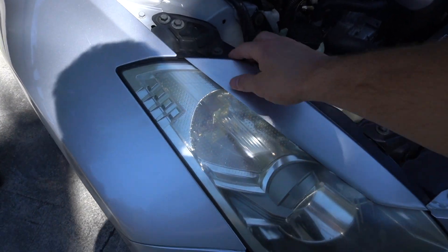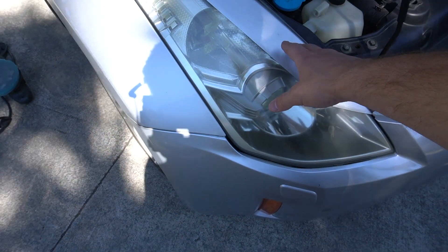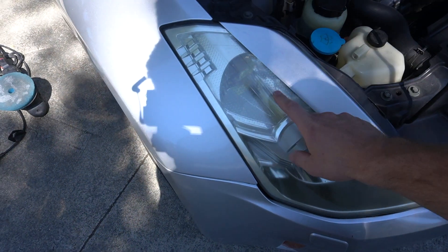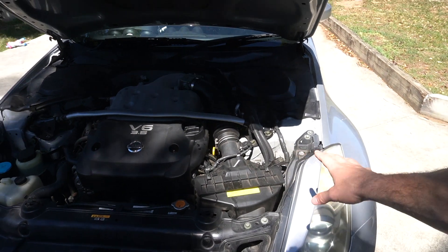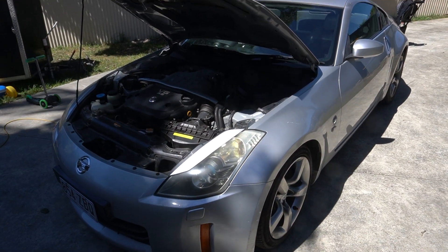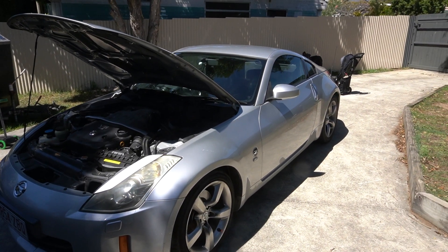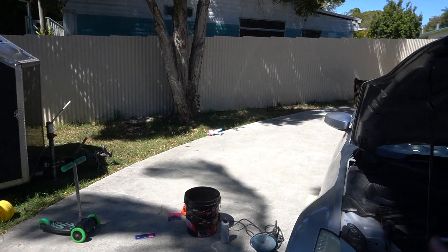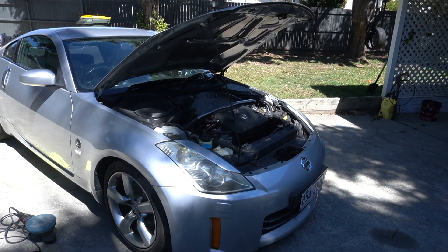So I've had a quick walk and I think these headlight covers are held on with double sided tape. I'm a bit reluctant to pull these off because if there's tape residue underneath, using something like goo-off to remove it might melt through the plastic. So I'm just going to try and polish these up as best I can. In the grand scheme of things, I don't think it's going to add or subtract too much value from the car anyway. People are used to seeing these with headlight covers. It's not perfect but it would be something that's tidy and someone can make it their own. So let's get to polishing these — I don't have any sandpaper here but let's see what the orbital can do.